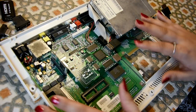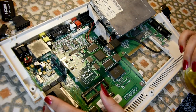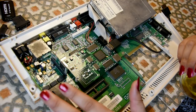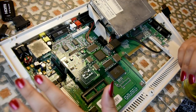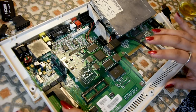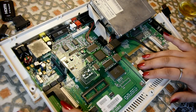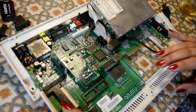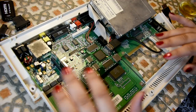I have plans. This is my second Amiga 600. You will know about the first one that I recently got recapped — it doesn't have a disk drive and it's got parts missing, so that is going to be a secondary one. When the Apollo guy contacted me, he recommended I get an expansion board — that one megabyte expansion board with an RTC real-time clock module on it, so that it gets the time.